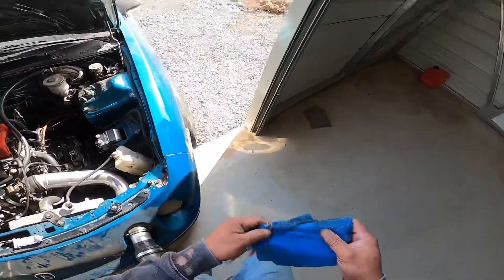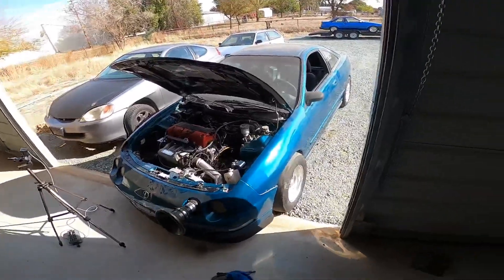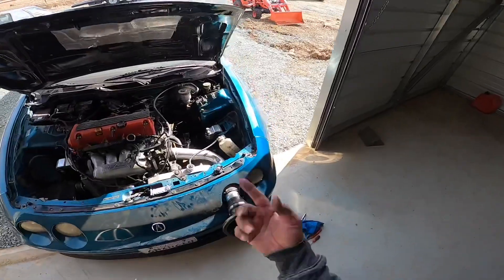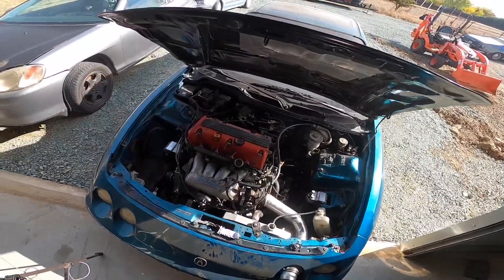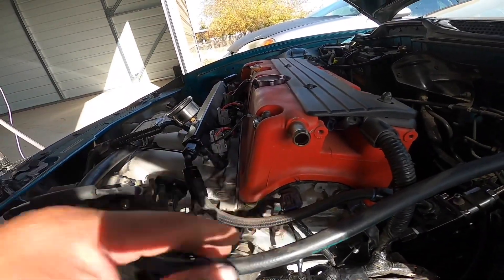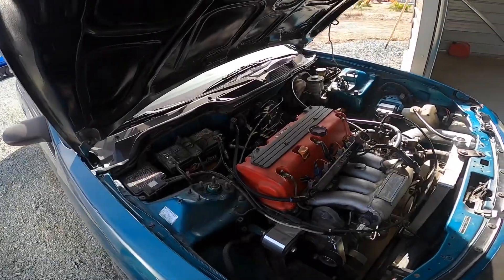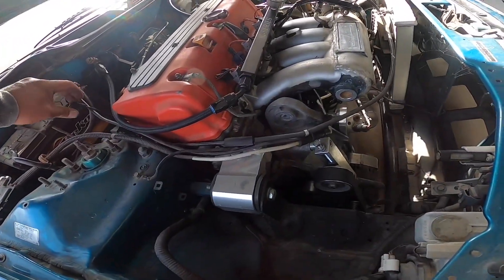Don't mind that knocking noise — it's the transmission. Unfortunately we can't take it for a drive because we're on the loud pipe and on slicks. My son would have driven this to the store and back like this — we're just going to keep running it until the thermostat opens. The line seems to be fine. I probably should put a fitting right here. With methanol you should be draining it every time — don't store the car with methanol in it, it's very corrosive.